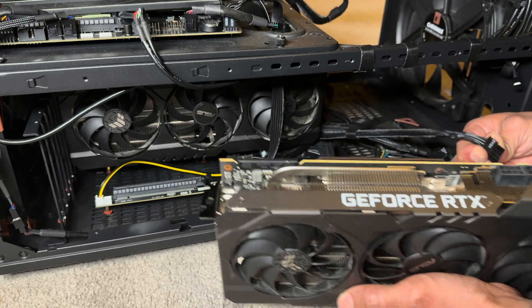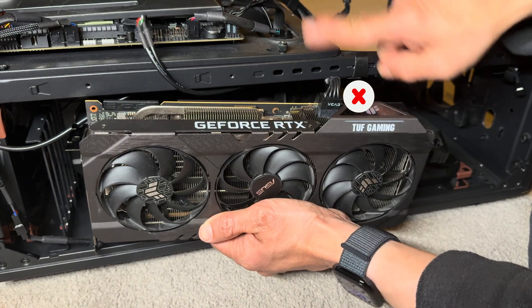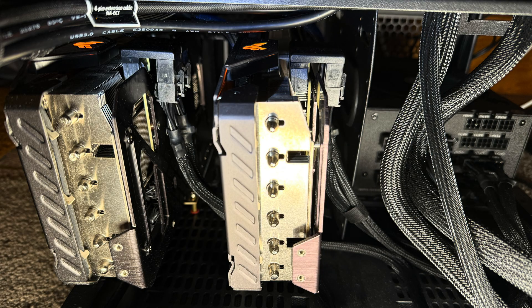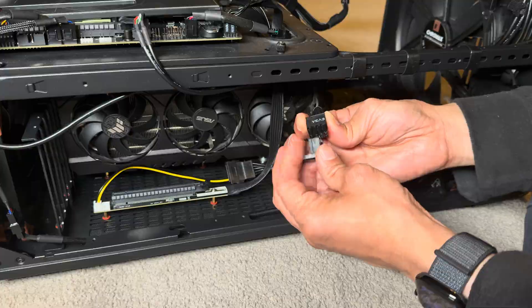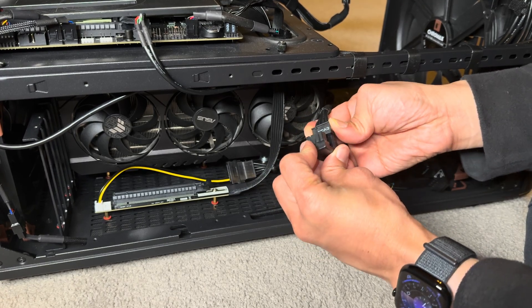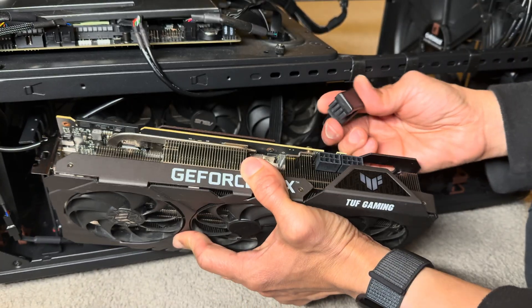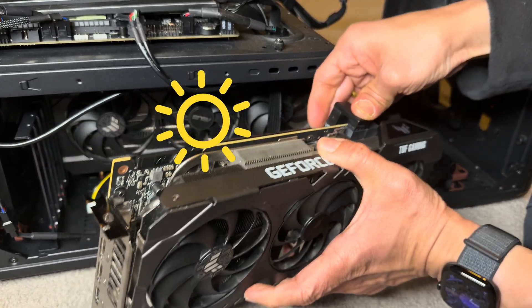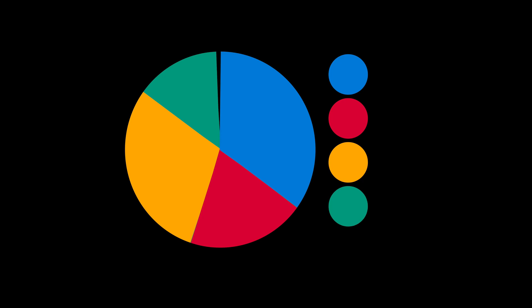Spending a little bit more on 3D printed shrouds and high quality fans gives me room to bring the heat factor down. For power, I'm running a used 2,000W power supply — more than enough headroom for 4 GPUs. The only real challenge is the two GPUs at the bottom deck. With standard PCIe power cables, there's no way to fit them without a hard bend that risks damaging the cables or connectors. The fix is a U-shaped adapter — it flips the cable 180 degrees so it comes from underneath and straight into the GPU's power connector. As for power usage, I'm not too worried. The 3090s are power hungry and not exactly efficient, but this is one factor I'm happy to spend on. I've got excess solar for about 8 months of the year, so electricity cost isn't really a concern. I've pushed the power slice higher to keep the GPU cost lower — a trade that works for my setup.